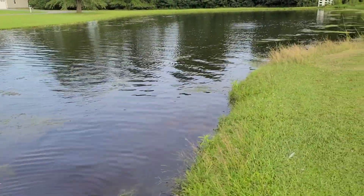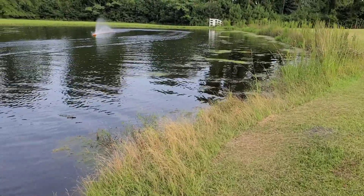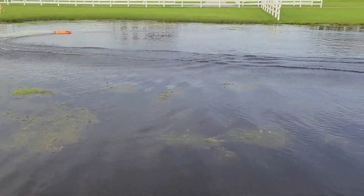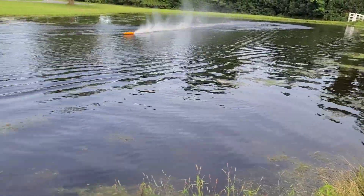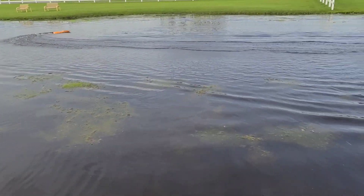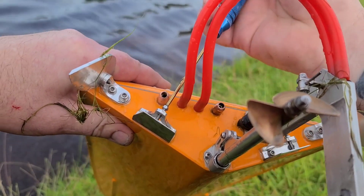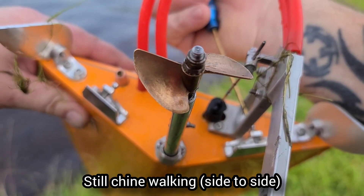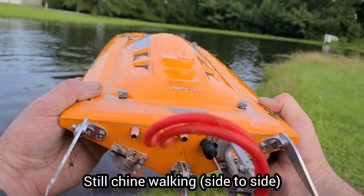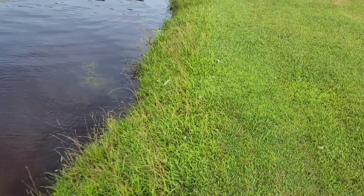She's running flat at low speed and flat at high speed — no list, no bounce. She's a little wet though, a little deep in the water. So I'm going to go up a quarter turn on both trim tabs because it was running flat but a little wet with some bounce. Let's see how that does.